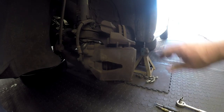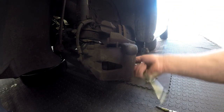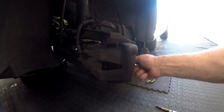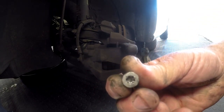We're going to replace both the disc pads and the disc. The first thing I would do is loosen the disc up — put a screwdriver into the vents of the disc so it can't turn. We need to loosen a little screw that holds the disc onto the hub; it's just a little Torx bolt. It's not very tight because the main bulk holding the disc in place is actually the wheel nuts. It's a countersink screw with a Torx fitting.